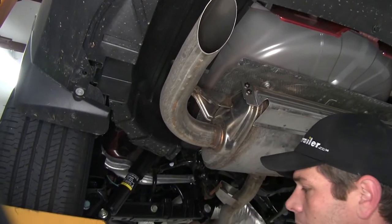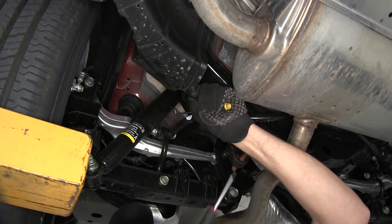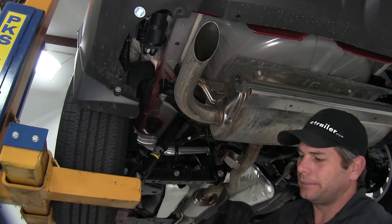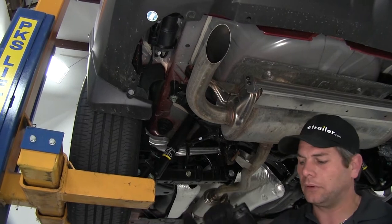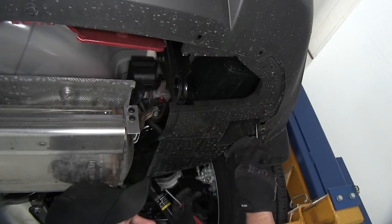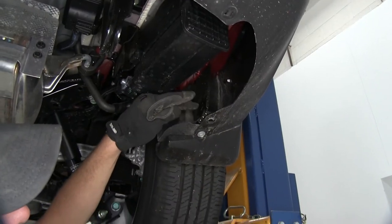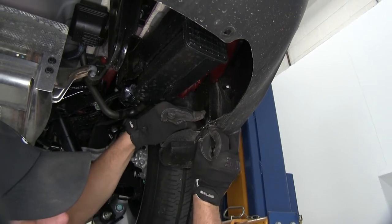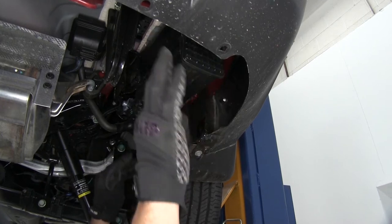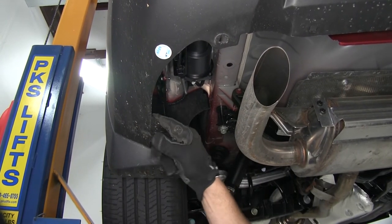A small Phillips screwdriver is all we'll need up here in the front. Just guide that down and out. Now these we're not going to be reinstalling, so we can set them aside in the garage, or if you're doing this for a customer just give it back to them. Now we'll come over to the passenger side and repeat that same process. At the bottom of our tab here, just behind the mud flap, we're going to reinstall one of the push pin fasteners we took out on the bottom — that firms it up. We want to be sure we do that on both sides once we have the covers off, so everything is nice and stiffened back up.